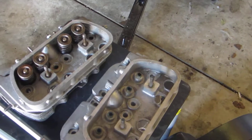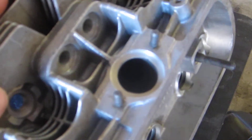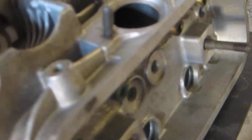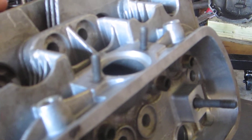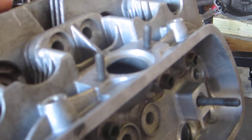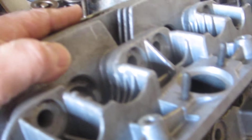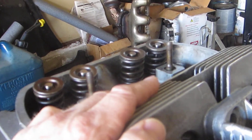I think these heads, with their angled intakes — these have about a 10 degree angle, as opposed to a 40 horse head which are flat — give you a variety of options for carburetion. They don't make 40 horsepower dual carb kits, at least not new anymore, but you can still get single port dual carb kits that fit 1300 and later heads. That's the compelling reason why I got these heads. I'm going to figure out which set is the best and sell the second set.